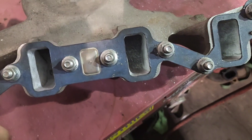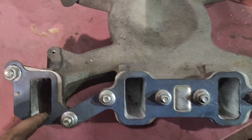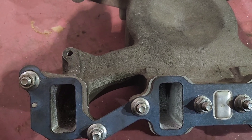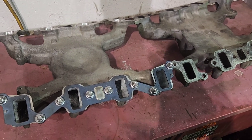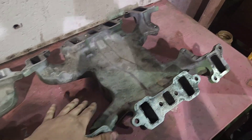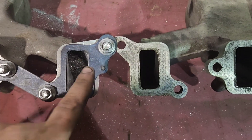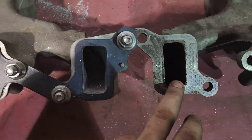It's kind of hard to tell how much I've done because I've already roughed in all four of these cylinders. Actually, I can go grab that S-Vin intake and show you the differences in port sizes. So I have both the F-Vin and the S-Vin EGR intake sitting here. You can tell a big difference on this left one compared to the factory port on the right.